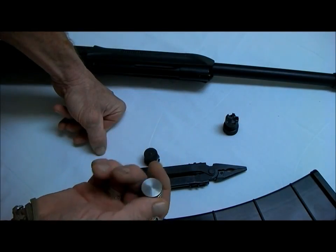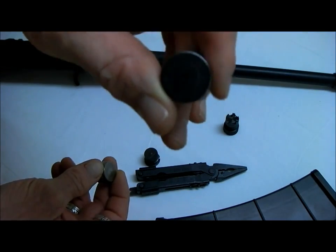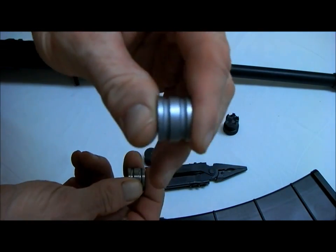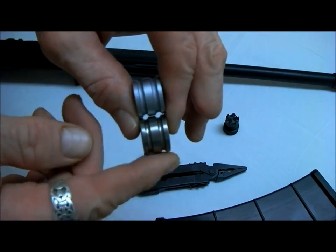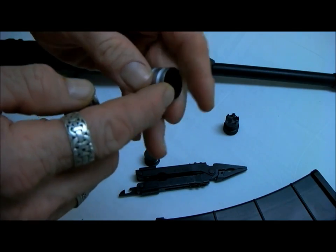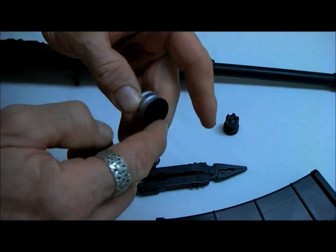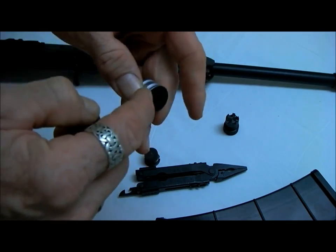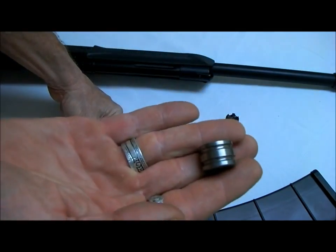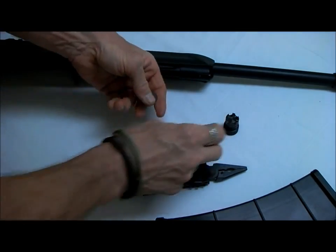In addition to having a good spring in there — which this does, it's very tight — you want to make sure that this piston does not snag up and that it is durable enough. Now this is a durable piston, but it's not quite as well made as the Tapco one. This one has some pretty sharp edges around the top, and my concern is that especially during braking it may snag up a little bit. This will work better, but it may be that this was actually an unnecessary expense at $9. But since I'm already in here taking this apart, I would replace both parts.